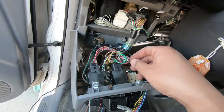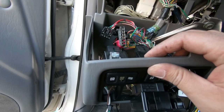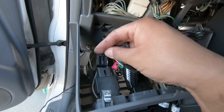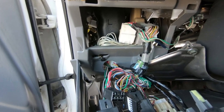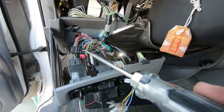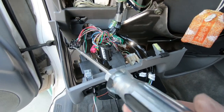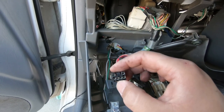As far as ignition goes, I used one of the rear window vent switches. This is the plug right here, and I believe this red wire is the one with power. Put your key in, second click, and there we go — you can see the light. Turn the car off, on, off. So that's going to be your power for the ARB switch whenever the car is turned on. That's this second wire right here.